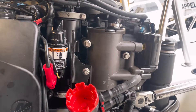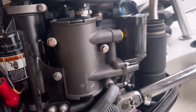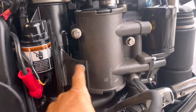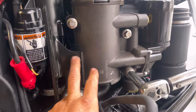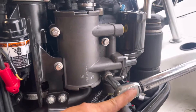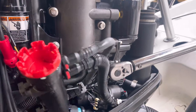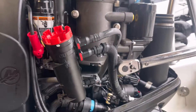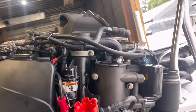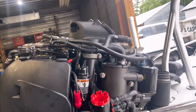With the lubed O-rings installed, put your four bolts in — don't forget to put this bracket on this bolt — and torque them all to 23 foot-pounds. Snug them all first, then go to 23 foot-pounds in an X pattern on all four. Clip your fuel filter back in, go up top, put the plastic intake on with the three Phillips screws, and you are done.